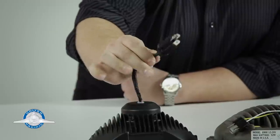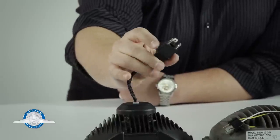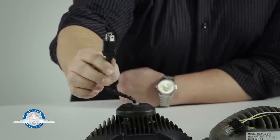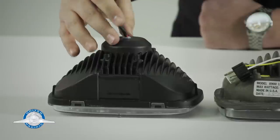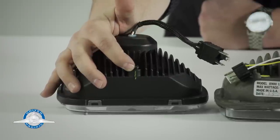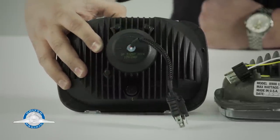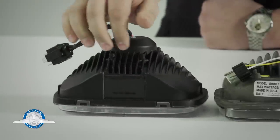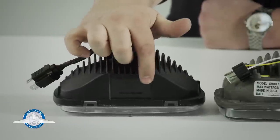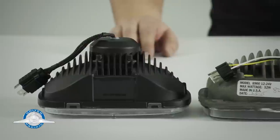The connector itself is really beefy. A lot of connectors are small and kind of fragile, but this one even has finger grips so you have a lot of strength available to plug it in and take it out. On the back side you can see the moisture vent — a really nice plastic moisture vent. The interesting thing is that in the production process, the top of the back side must have been open, and to seal it they use black potting material. That tells us the entire internals of this headlight are sealed for waterproof ratings.